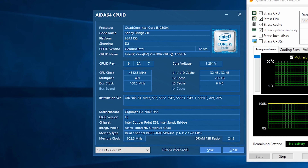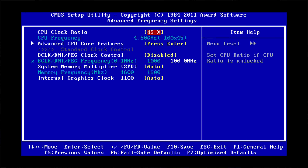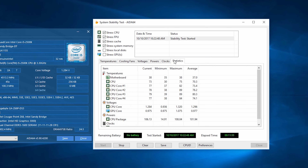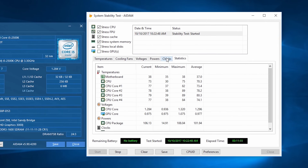We were going to take it higher. We rebooted the system, opted for 4.5 gigahertz, and surprisingly it passed at 4.5 gigahertz as well. This was at around 1.34 volts. Keep in mind this power supply is supplying terrible voltage and the MOSFETs on this motherboard aren't the best. I was surprised it was kicking at 4.5 gigahertz, reaching a maximum temperature of 90 degrees — pretty much our maximum threshold.